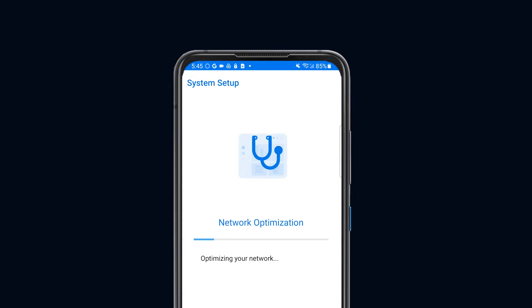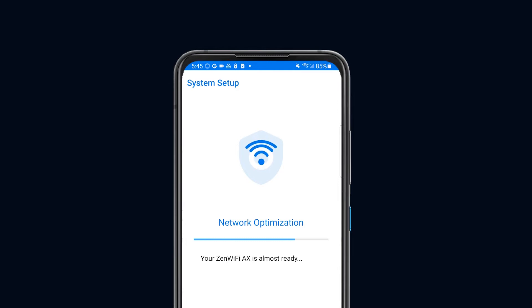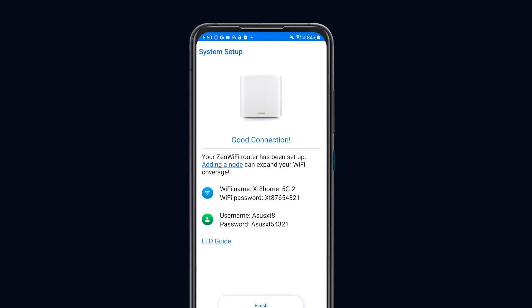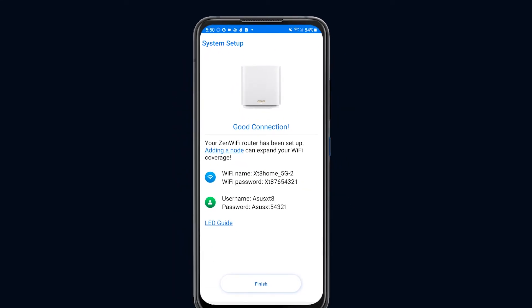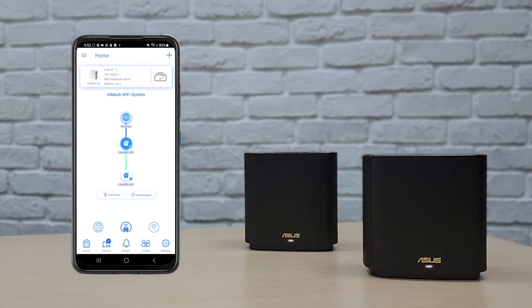Then go back to the ASUS Router app. This might take a few minutes to complete your system setup and activate your mesh network. Make sure you reboot the node to refresh connectivity status once you have positioned it in an optimal location. The LED light will stop blinking and turn sky-white when it's accomplished. The following page will show you all the settings — you can take a screenshot or find it in the management interface of the ASUS Router app later. When you see the topology on the ASUS Router app and both your router and node turn sky-white, your network is ready to explore. If you have further requirements, find more information on ASUS WRT or contact support.